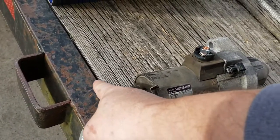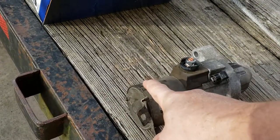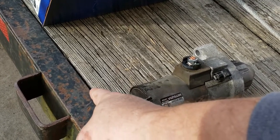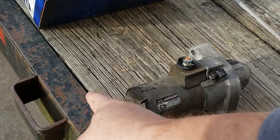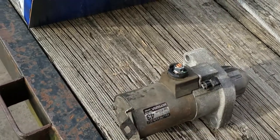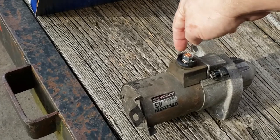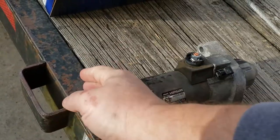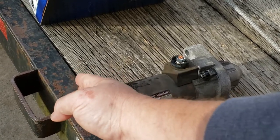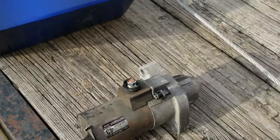I highly recommend pulling out the knock sensor sitting right behind the starter, about two inches away. It's a one and one-sixteenth inch wrench to get that knock sensor out — it comes right out and gives you a lot more free clearance. Do not try to use a ratcheting wrench, air powered or anything, to pull this out, because the thermostat housing is in the way and you will get your ratcheting wrench stuck. Don't do that — learned that the hard way.